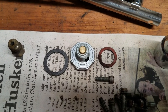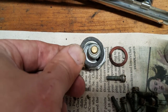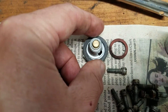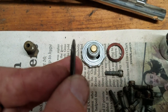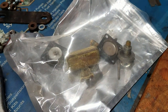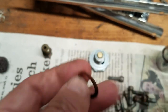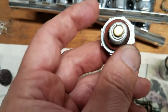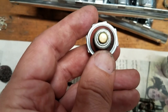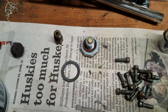There was one other problem. The previous owner used a carb kit and used the wrong gasket for this power valve — it doesn't fit the carb body correctly and you can see it's distorted. Fortunately he gave me all the leftover parts from his rebuild, and in there was a fiber washer or seal that goes on there and fits the hole and valve correctly. So we're just going to reuse that one for proper sealing versus the incorrect one that came in the kit.